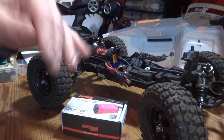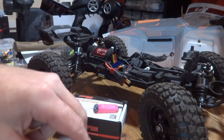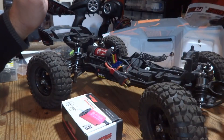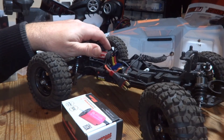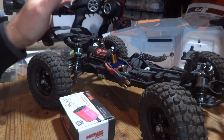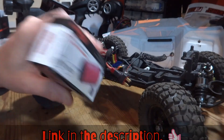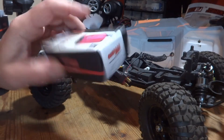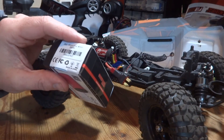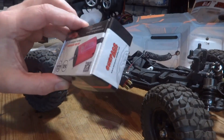The thing I was most worried about was cogging, and that was non-existent — it is as smooth if not smoother than the original motor. Considering the price, you really do get some bang for your buck. It did take me a while to get the pinion off, so I'd seriously consider getting a pinion puller. I would absolutely recommend fitting a Surpass Hobby 5900KV motor to your HBX 901A — it's super cheap and the results are instant and frankly amazing. They also do a selection of different KVs — around 2200, 3400, and others — so if you didn't want the 5900 there are options.